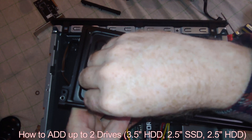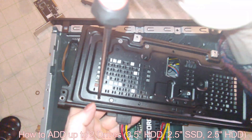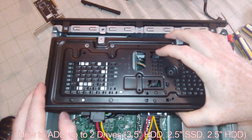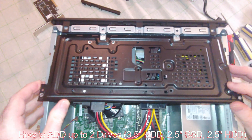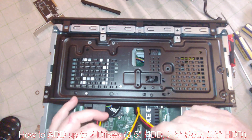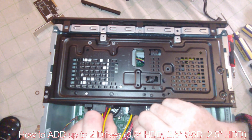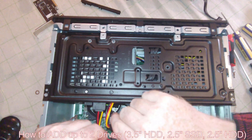This is the right screw. There we go — I'm just going to put two screws in here and call that a day. Voila! There you go — adding a drive to the HP gaming computer so that you have additional storage. That's one thing this computer is rather weak in. With this cable, we don't want it to end up in one of the fans, so you have to be a little careful. You don't want this thing to end up in the CPU fan or the graphics card fan, so we're going to tuck it in there.